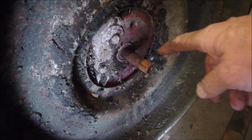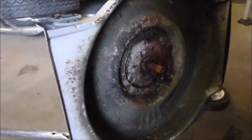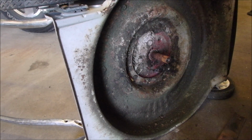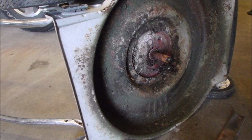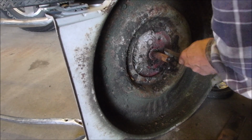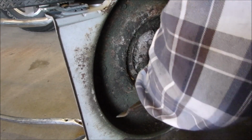All right, this is the shaft of my 1970 Craftsman Eager 1 Tecumseh. It was a little hard to get off. But there's a keyway in there, not a formed keyway. So I'm just going to get a little brush. I've got one sitting around here. I'll put some anti-seize inside the blade adapter, which should do it. I mean, it was on there. I don't think there's 100 hours on this machine yet.